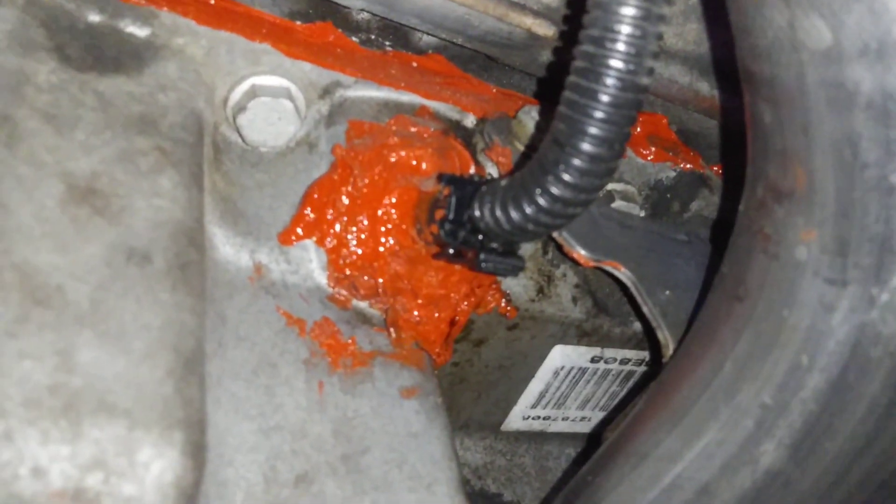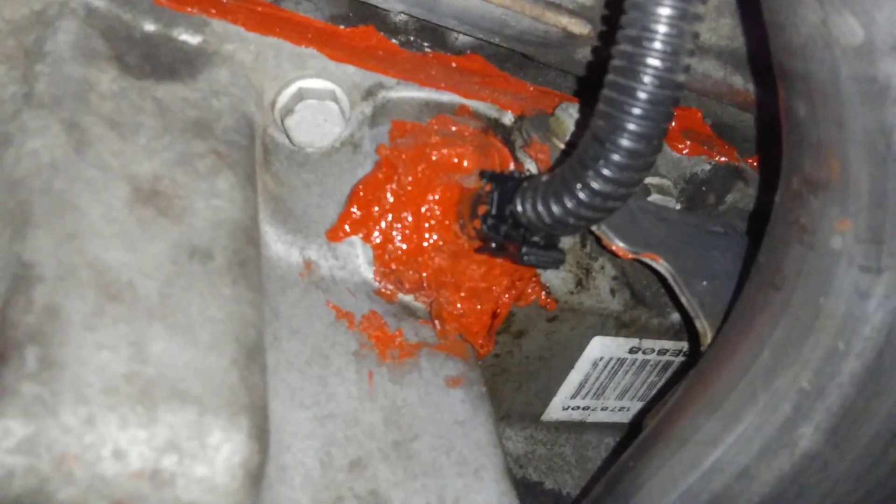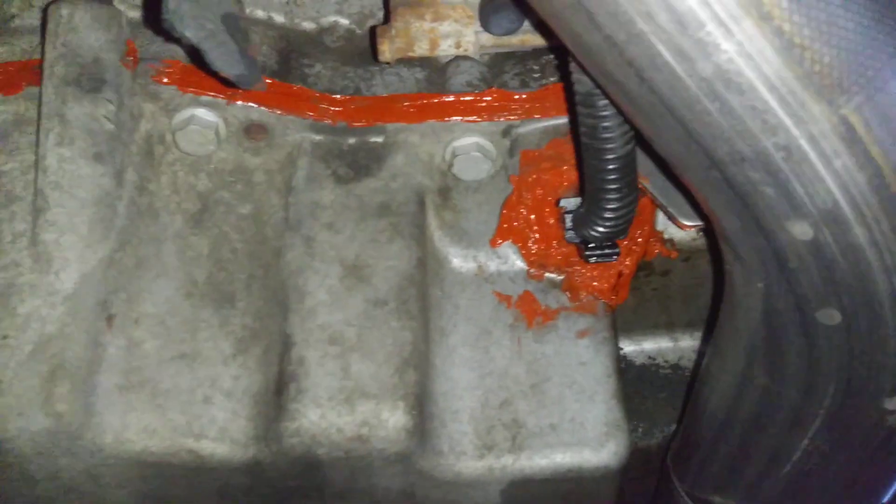Because you have to take the oil pan out again. So I cleaned the surfaces as much as I could and applied RTV sealant — I believe it's made by Permatex — and let it sit for at least a day. It's about 50 degrees here, so I wanted to make sure it had time to cure. It's working pretty well. I don't expect it to be completely airtight, but it has kept the leakage down pretty well.